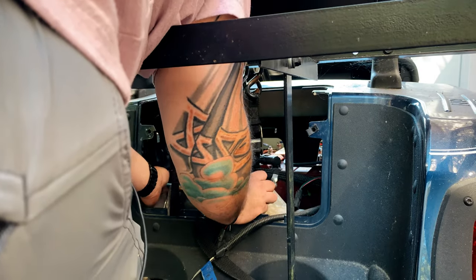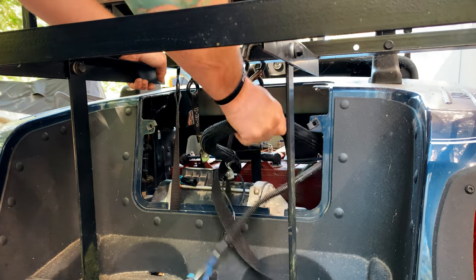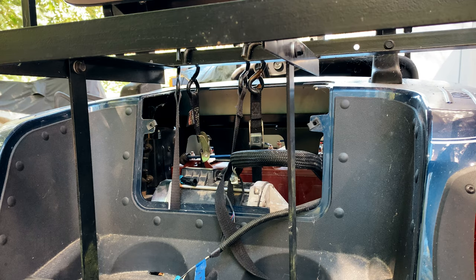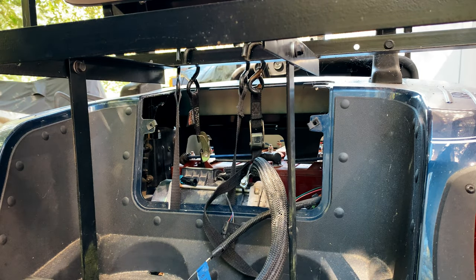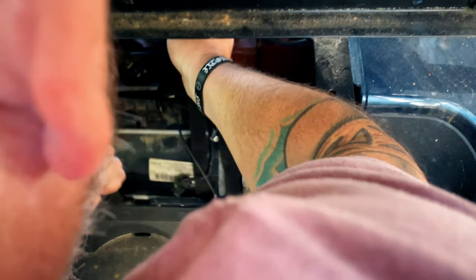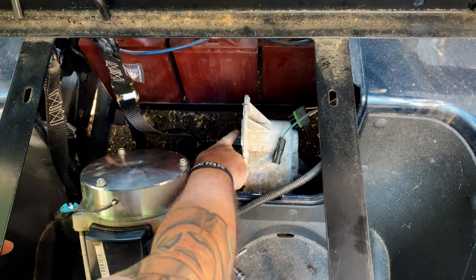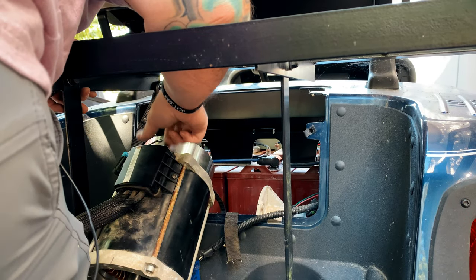We should be good. Let's see if it slides — yep. I'm going to go ahead and pull these wires through so they don't hang up, because this golf cart motor is pretty dang heavy — impressively heavy. I've pulled it out twice already just to check the armature, make sure it spun freely, and to replace the e-brake on the end. It is a good rule of thumb to check your spline gear — I can tell it's moving freely, so there's not a problem in the hubs or the differential. It's got to be within this motor or the batteries.